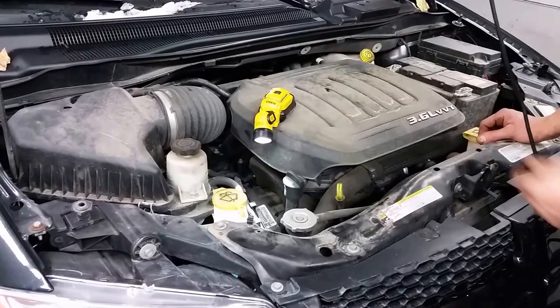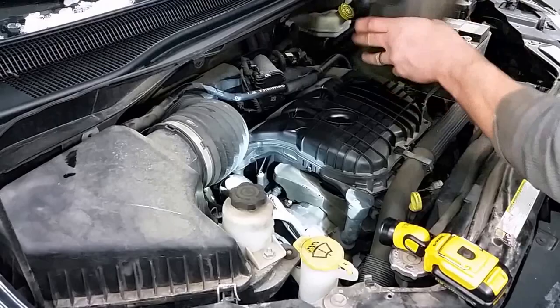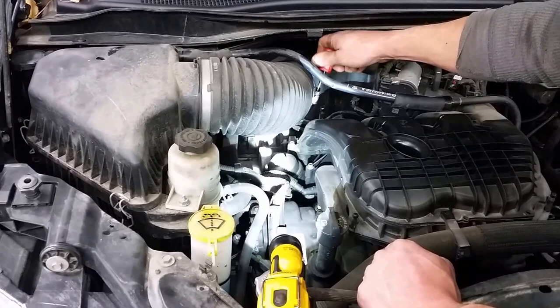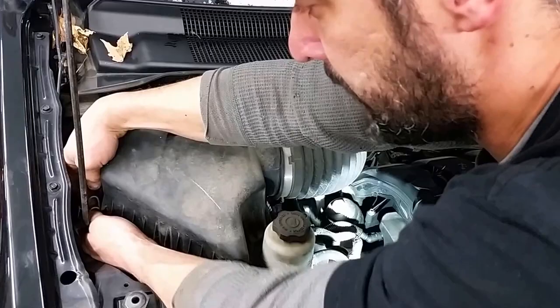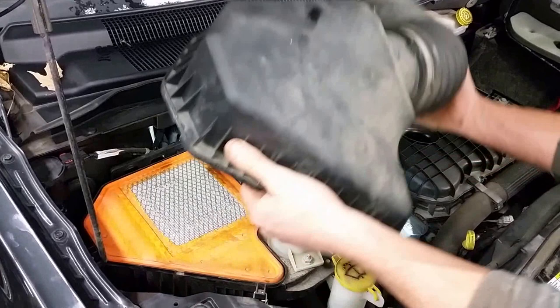The next thing to do would be to take a look at the air filter and remove the oil filter on this model. We're going to begin by popping this upper engine cover off — it just snaps on, with four little pegs that sit on the intake manifold. After that, we're going to take a small screwdriver and loosen up this air duct on the intake manifold. Then remove the breather hose off the air filter housing, unclamp the clamps that hold it on, and take your air filter housing out with a slight twist and set it out of your way.